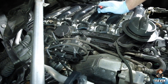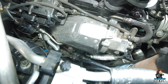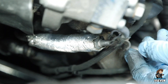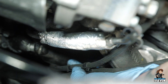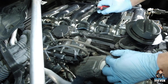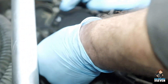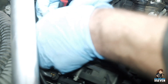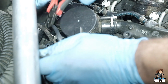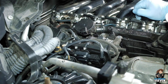This is the longest one and we're going to free it up - it goes on the bottom and in between. It's a pressure converter output, but it's a feed to the wastegate actuator. It actually has a factory splice somewhere down the middle. Everything is factory in this car, even this clip - usually it all gets brittle and broken on most cars, but this one has everything factory. So we're going to cut it in the middle and then at the pressure converter output, pull this out and cut it here to give us space.